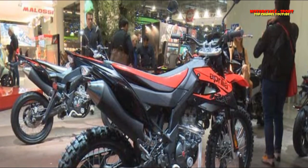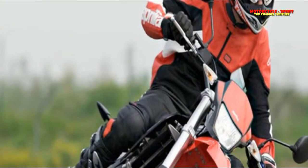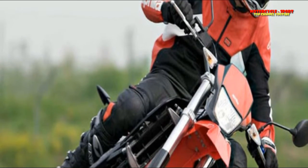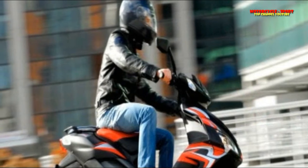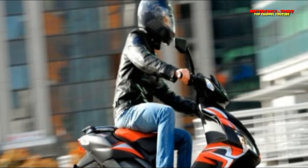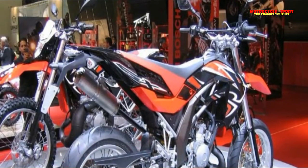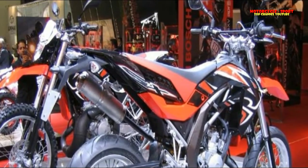The kit includes a set of 4 single groove pistons with a surface treatment to guarantee smoother action. These components alone ensure about a 4 horsepower increase in maximum power. In order to further increase performance, a cylinder heads kit is also available, which replaces the original heads with new ones that boast numerically controlled machine intake and exhaust ducts in order to improve fluid dynamics.